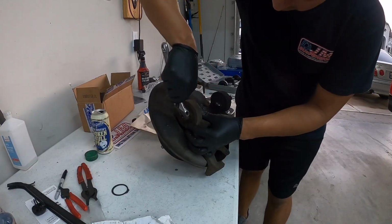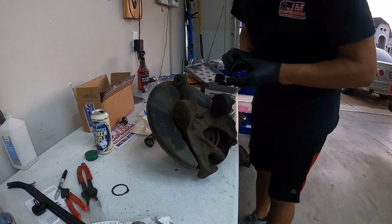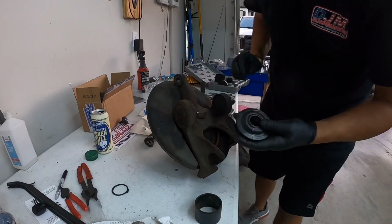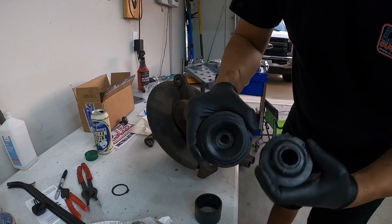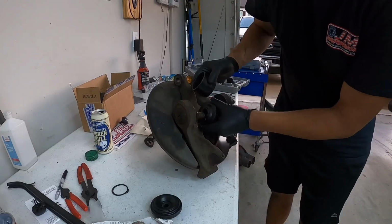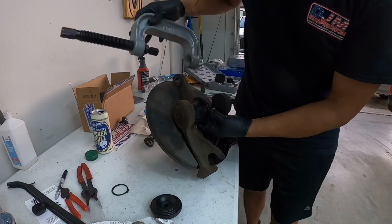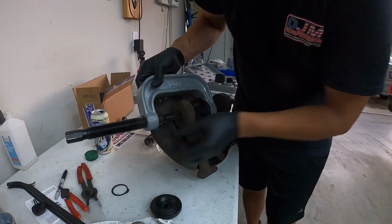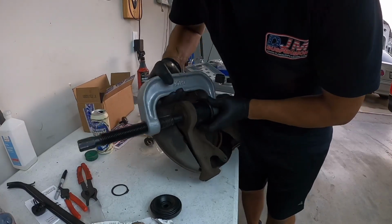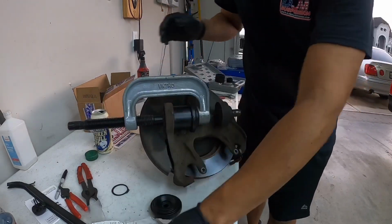Take these grease fittings off first. All right, we can go ahead and set up how we're going to remove this. You have two different cups. This cup has a larger hole and this one has a smaller hole, and that way, with this one, we can feed the ball joint through. We'll set this up like this, apply the pressure down this way, and the ball joint will just slide that way. All right, so now this is in the middle. Now we can get our impact.